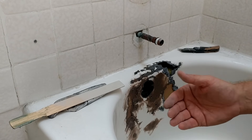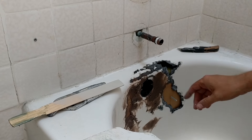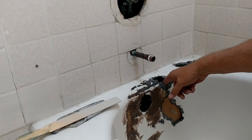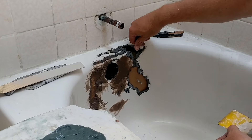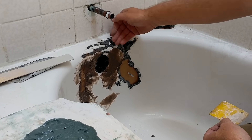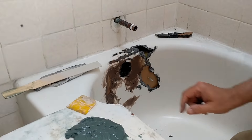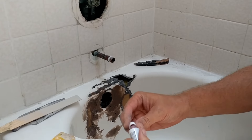We're going to use a different Dynoglass for the front because it's smoother — it doesn't have the fiberglass fibers in it, so it finishes really smooth, and it's extremely hard. Up here there's a little bit of insulation as a backer, so I'll fill that up a little where I have something to put the bondo in. I won't need to worry too much about the cardboard method there. Let me mix up some bondo and show you how this works.